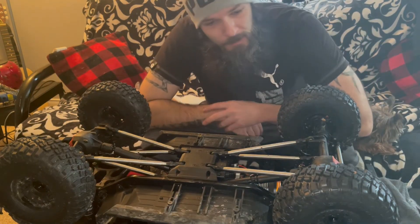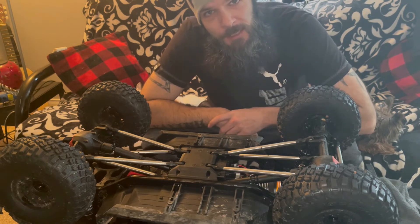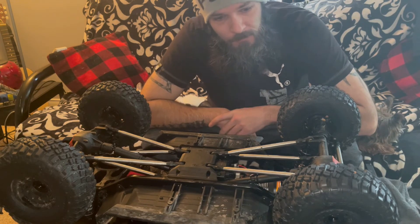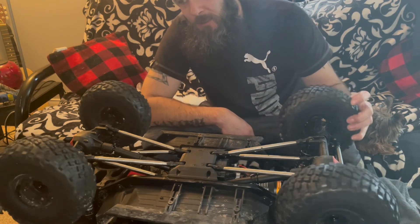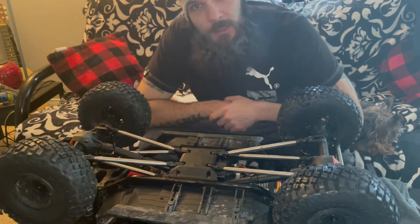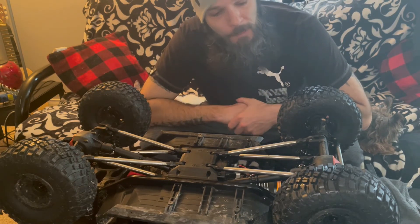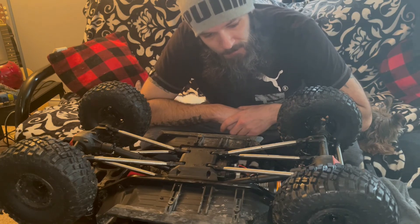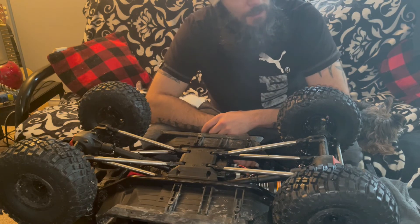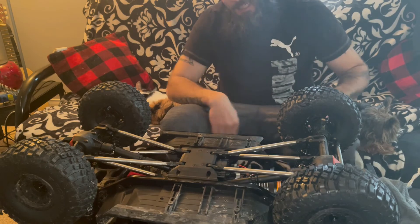So that was a look into the diffs. My personal recommendation: swap out that grease. It looks like it's just going more liquidy as time goes on. Putting mine in there actually quieted it up a little bit — you're not getting full metal on metal all the time, which makes it pretty decent. Hope you guys enjoyed, and check out the rest of the channel to see this thing running. Thanks guys, we'll see you in the next one.